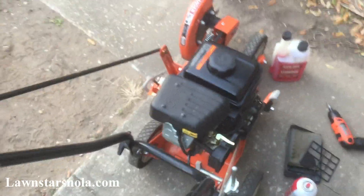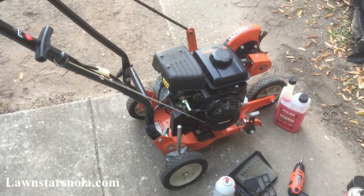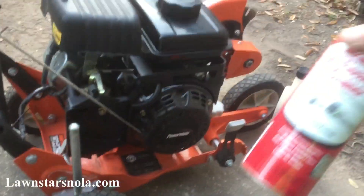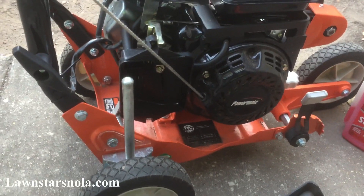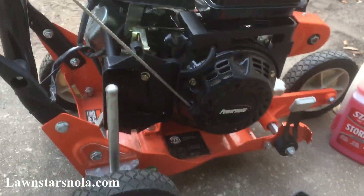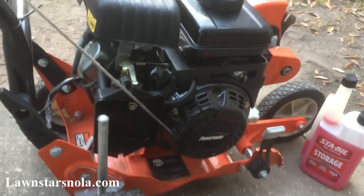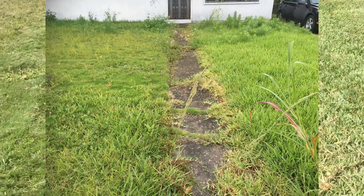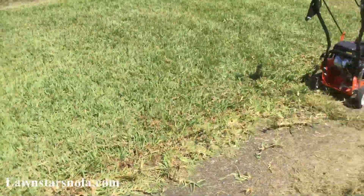I was encountering the same thing and decided to use a little starting fluid, except I didn't really have starting fluid — I had some electronic cleaner. So you just pull the cover off your air filter and spray right up into that little hole, give it a little burst, one or two. After doing that, it started on the second pull — very nice and easy. Now that I know how to start it quickly, it's really gonna make a difference. Thank you for listening, hope it helps.